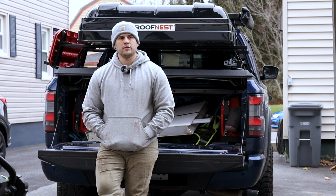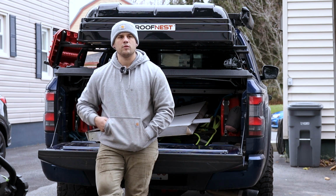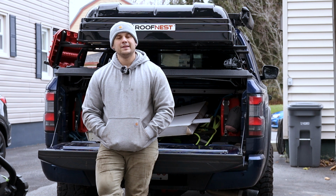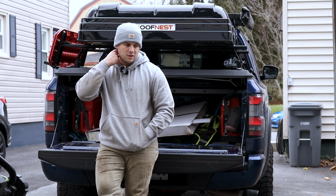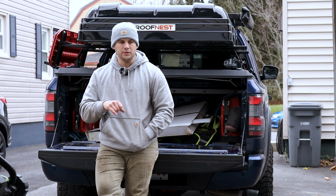This video I'll just be going over the install process, and like I said, they include hardware. There's like 1 long bolt and 4 other bolts that I understand will replace 4 factory bolts, but then there's still 2 factory bolts that are going to be unaccounted for. I don't want to go out on a limb and say this, but unless I drill through that skid plate, there's no way to get those 2 bolts on.